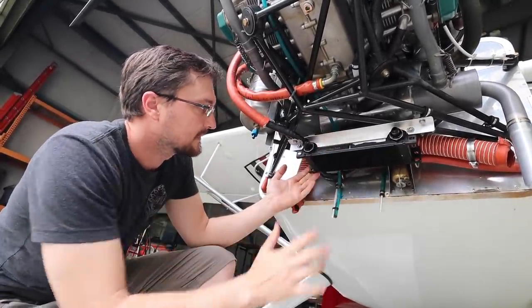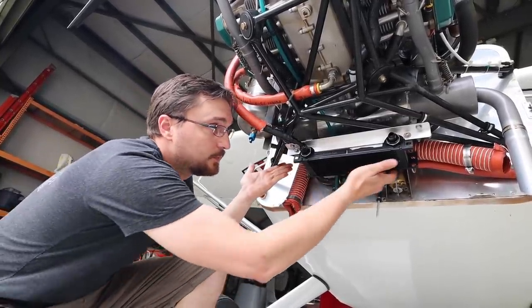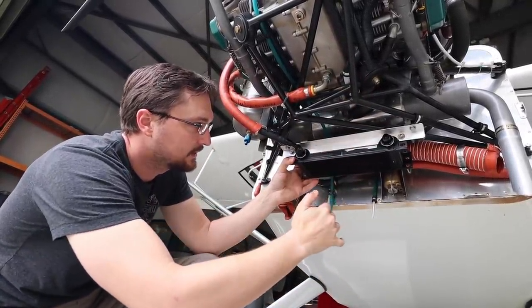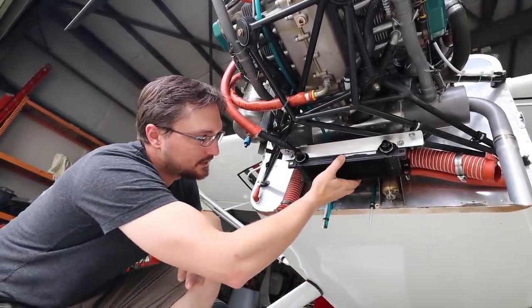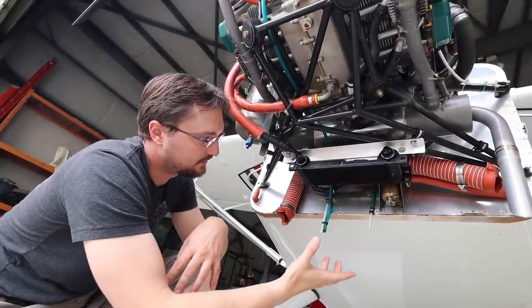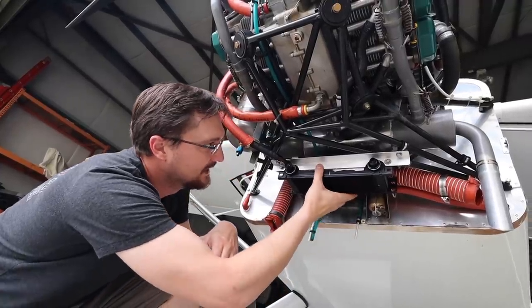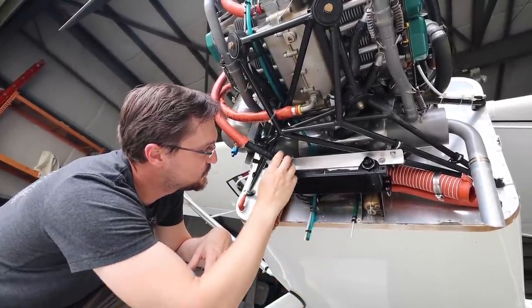We've got the oil cooler not completely mounted. Our front mount is here; we've got to build a new piece to support the back, but this does hold it in place. This is going to catch exit air coming out of the bottom of the cowling. It's not necessarily the freshest air, but with radiant cooling like this, a radiator will provide some cooling effort even if it's not in an absolutely ideal location. Since all we're doing is supplementing the original cooler and almost tripling our total radiant capacity, this should be pretty good.